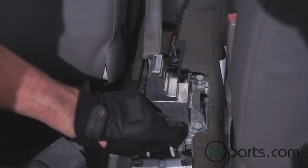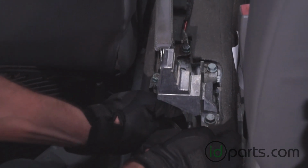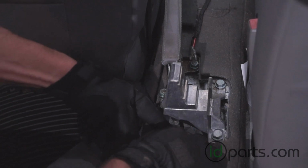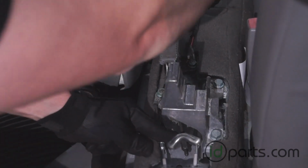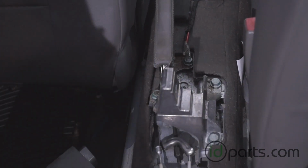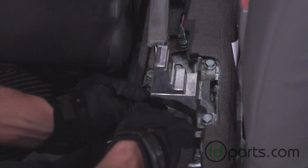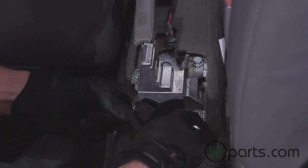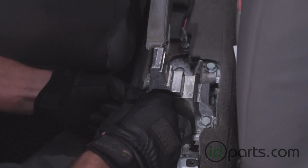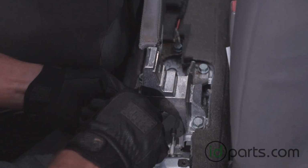Both ends have come through the undercarriage into the passenger compartment, and we'll hook that U-shaped bracket to each of the cables individually. You may have to loosen up the nut a little bit more because these cables aren't going to be stretched yet. Since they're brand new, they're going to be a little bit tighter than the ones you took out. Again, I wish I found my ratcheting 10mm, that way we would not be playing with this short little thing, but hopefully next time I'll find it.